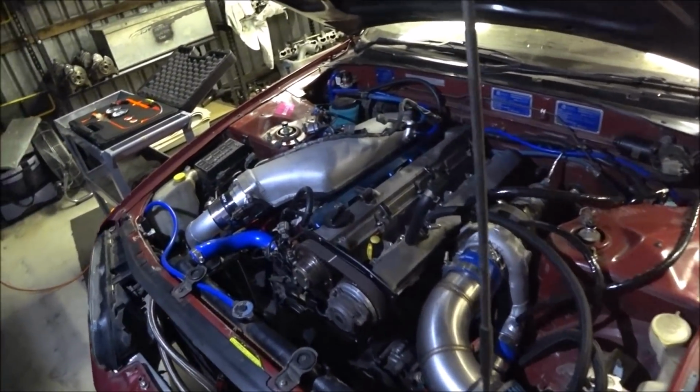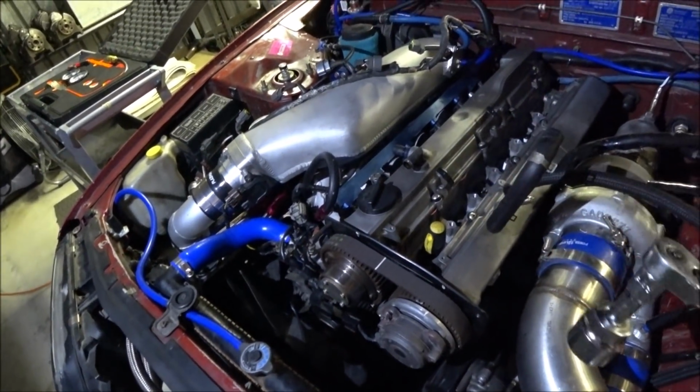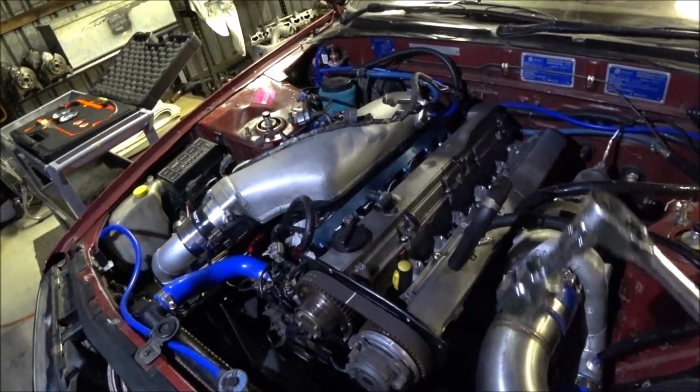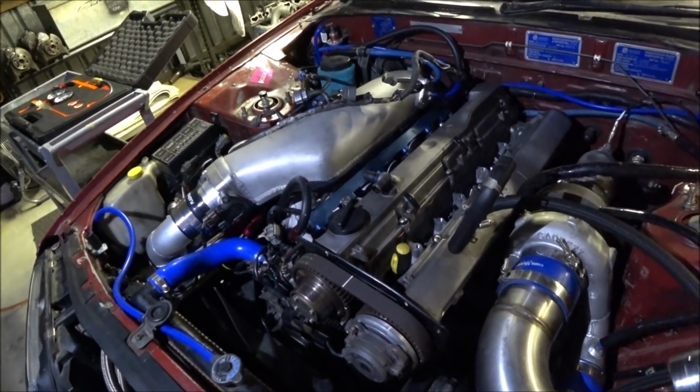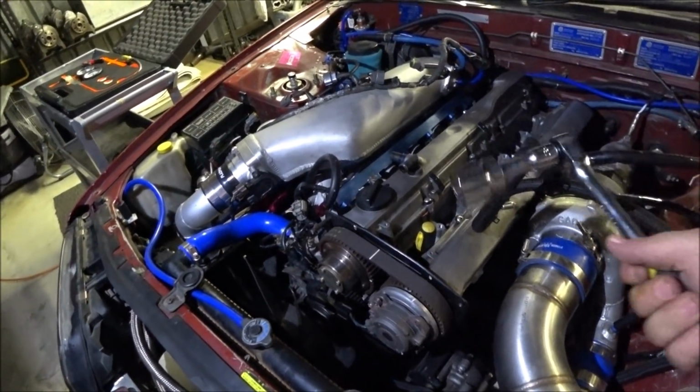So I've done a bit of lighting mods so I can see. For this test, first thing I have to do is bring cylinder 1 to top dead center. Now we do have the timing marks to help with that, but we're not going to be able to do the others like that, so pop a screwdriver in there. It'll also help to double check what I'm doing.